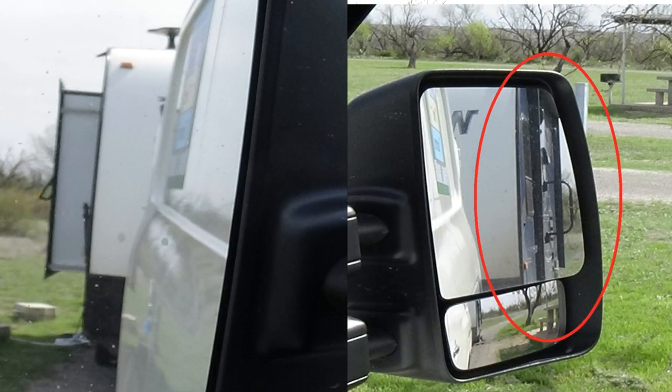For me, the first step is always lining the tow vehicle with the trailer. What I do whenever I line up to back up, I'm always just checking my mirrors. To see that I'm level and even, I start with my mirrors. I'm going to show you a series of three side-by-side mirrors showing the driver's side on the left and the passenger's side on the right. My goal is that it look even on both sides — I don't want to see more of the trailer on one side than the other. In the first series of pictures, you can see more of the passenger side door, which I don't want. So I've corrected, and now the second set shows those are even.